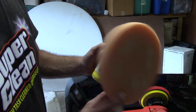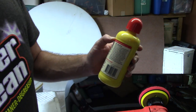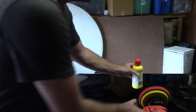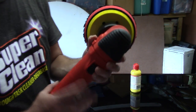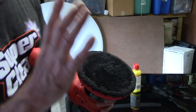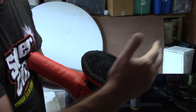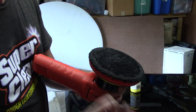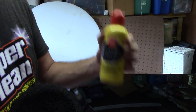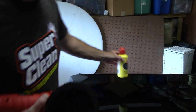I think I showed this to you guys the other day — this is their correcting pad, their orange pad. You can use it with this if you want. I'm actually going to use it with the microfiber fast pad, which I have attached to this 6-inch Griot's orbital polisher. According to the box, it goes after moderate or severe defects depending on what type of compound you use. I don't really see the complete compound as the most aggressive compound on the market — actually, it's not.